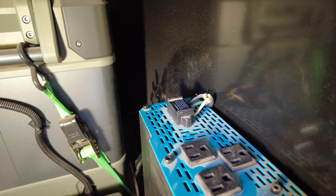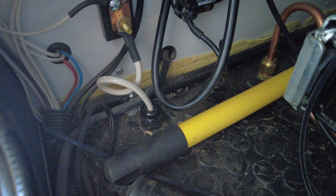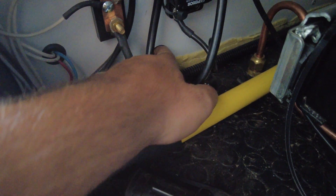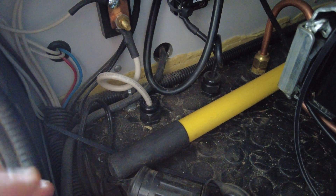All I did really was this: you'll see right down here I drilled a hole through this side. I used a basically watertight seal on it and ran that through to the cab. So that wire runs around — this wire here goes underneath, it's tie-wrapped, runs all the way through the top up here. That wire comes through there, through this hole right where my finger's pointing, goes around, goes all the way under the bed into here. Now I will say this was a lot thicker than I thought it was. Putting that nut to make it sealed tight was a bear — that was probably the longest piece of this whole project.